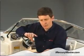First let's start with a quick discussion on what pitch is. Pitch basically refers to the angle of the blade. Thinking about a screw moving through a piece of wood, pitch is in theory the amount of distance that a propeller would travel in one revolution if it was moving through a solid medium. So a 19 pitch, for example, would move 19 inches, whereas a 15 pitch propeller would only move 15 inches.